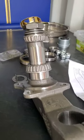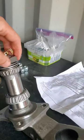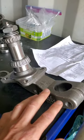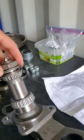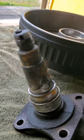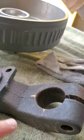Progress — I might actually make the race weekend in Calgary, first time back on the race machine. This is the new spindle; it's not the exact model as the old one, but the measurements are working, the bearings fit on the races. I got a nut to fit — it's a different nut than the old one. The old one has a much smaller nut, but everything else is going to work out.